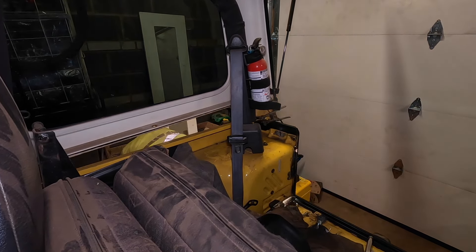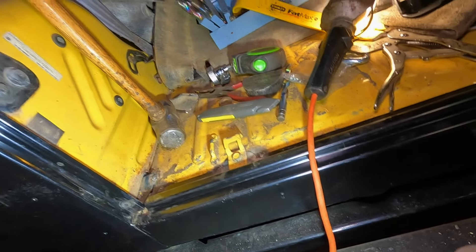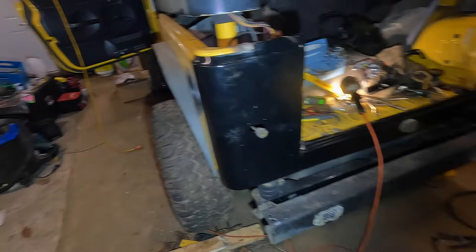This side is all put together — you can see it all lines up very nice. The plugs are ready to go, this side is also done. Only thing left is the two plug welds on the top; all the welds on the inside and back side are done and she's a Jeep again. Now we have rear corners. The only thing left is a little bit of seam sealer here, and it actually tucked right in nicely — doesn't need anything. Because there is a gap here I will be covering the entire thing with some sort of coating. I'm probably going to do the monster liner on the entire Jeep at some point, but we're going to do the interior first. Let's move on to the front.